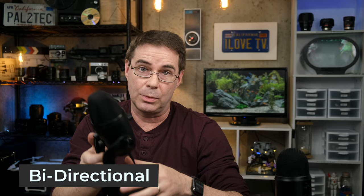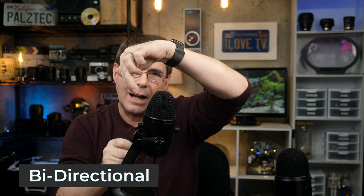Cardioid is the best one for general use because when you're speaking into the microphone, it won't be picking up background noise. Suppose you're typing on a keyboard — the mic is not going to pick up as much because the entire back side of the mic will not be active, just the front. And lastly, you have bidirectional, which tells the microphone to only record from the front and the back, not the sides. This is great if you're sitting across the table from someone with only one microphone — put it between you and it picks up both speakers while ignoring the sides.